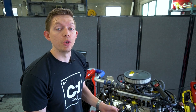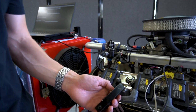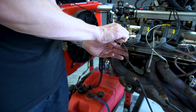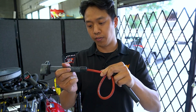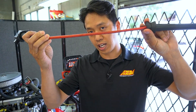We've got our timing light connected to the battery and we're going to take the pickup clamp and clamp it to our number one plug wire. Be mindful that if your timing light has a clamp with an arrow that says 'plug,' you want to follow that direction. In applications where you have a coil-on-plug and don't have a wire, a simple trick is to take an old wire, strip off one end to leave a little lead, shove it into your coil-on-plug stick, hook that up to your harness and to your plug — now you have something to clamp onto.